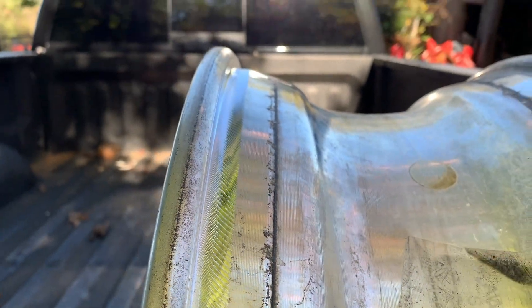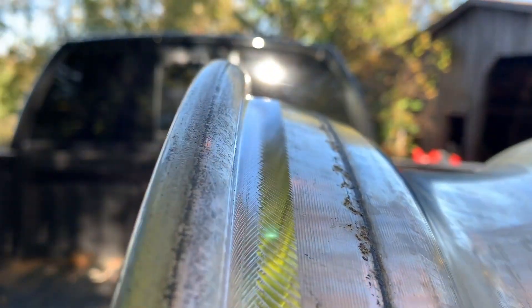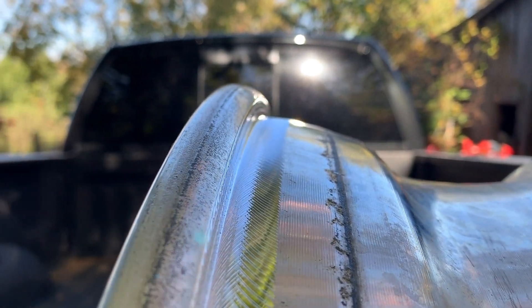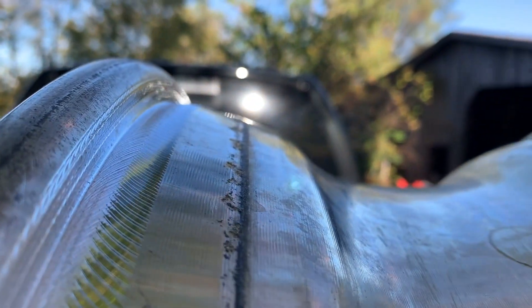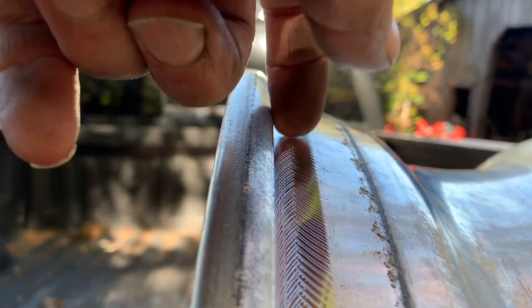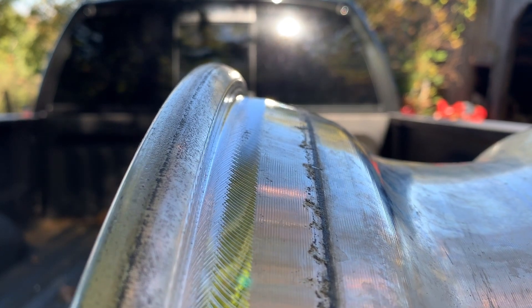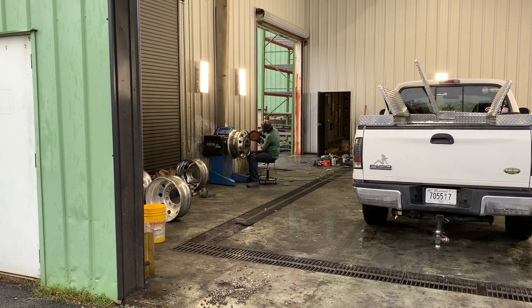Here's what makes a difference — why you mill this wheel down so you can fit a non-commercial tire. You can see down this edge there's a nice flat edge — that's how all non-commercial wheels are going to be. Over here, this side hasn't been cut yet and you'll see it's all rounded and obviously a whole lot bigger. Basically they just took this edge and brought it down, and brought this edge over, and now a tire fits on it. So I'll be able to run a regular 22 inch tire instead of a 22.5.